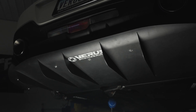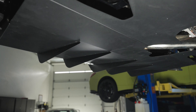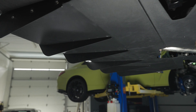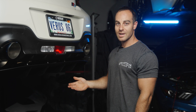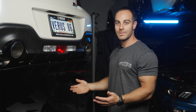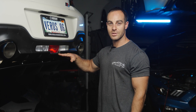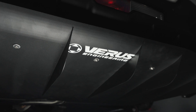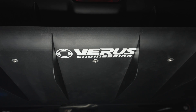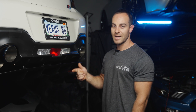We are next to our GR86, which is also sporting a rear diffuser. This unit is not speeding up the air, but it's slowing it down back to ambient. As you do so, you're generating rear downforce. One thing we noticed with stock cars — and this is what we get from feedback from customers around the world — is that the car is a little floaty when you get above 80 miles an hour. This does a great job of fixing that floating feeling because you're actually adding rear downforce and also reducing drag, so you're not getting that drag penalty which is generally associated with downforce. It's a great addition to a stock car and not enough to really upset aero balance like a rear wing with no front aero.